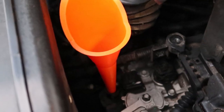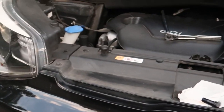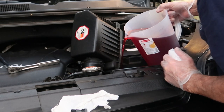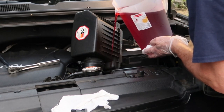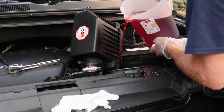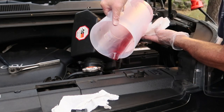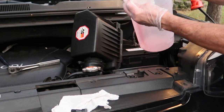Before we can refill the transmission fluid, you're going to need an extended funnel and place it into the fill port. I thought I picked up a long enough funnel but it wasn't quite long enough, so make sure you grab one before you start this project. I'm coming in at a bit of a weird angle because the funnel isn't quite long enough, but if you go really slow you should be okay. I spilled just a little bit, but that's okay — I can make up for it at the end by adding just a little bit extra. The main reason I'm being so careful is because this is the first time this transmission has been serviced; I know exactly what I took out and I know exactly how much I'm putting back in. That way I really won't have to use the service port on the side of the transmission to check if it's too high or low, which avoids a lot of mess at the end.